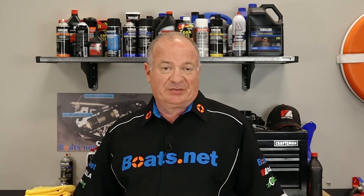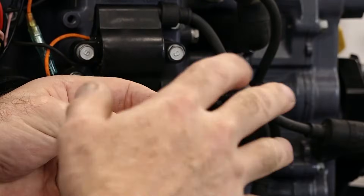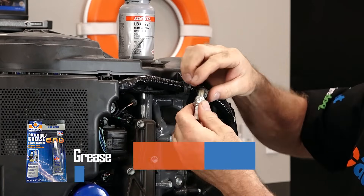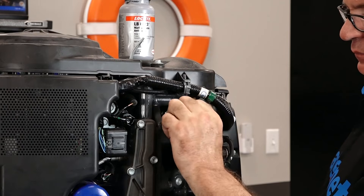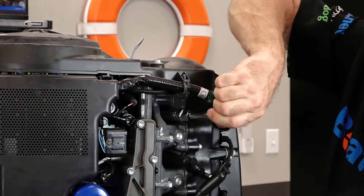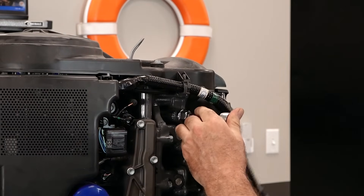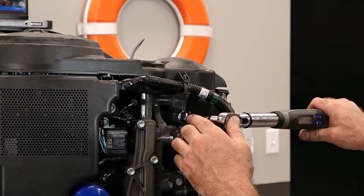Once you're done and you've got spark plugs that don't look quite right, you probably just need to go and replace them all, and we have several videos showing you how to do that. As you put it back together, don't cross-thread the new plug as you install it, because then you're going to have a real mess. Also check with the manufacturer because some recommend a thin coat of dielectric grease or a non-seize lubricant — but be very careful of the brand of anti-seize you use; make sure it is marine grade. Don't over-tighten them — get them hand tight and somewhere between a quarter and three-quarters of a turn should do it for a new spark plug. Once that washer has been compressed, it doesn't take nearly that far to get it back to torque, so if you're reusing your plugs, make sure you follow the torque specifications for that particular plug.